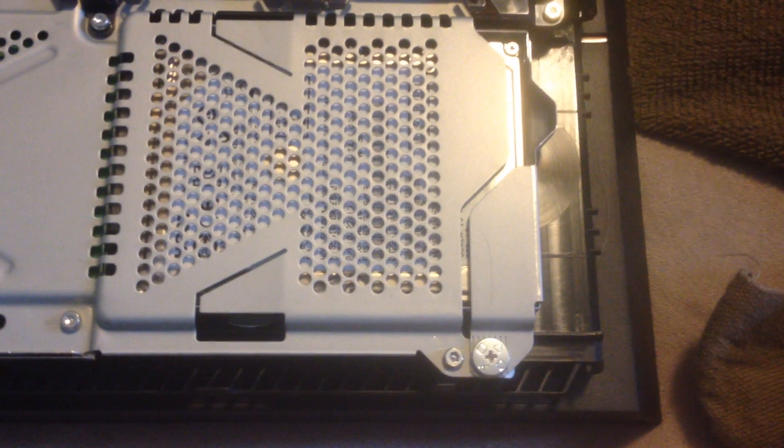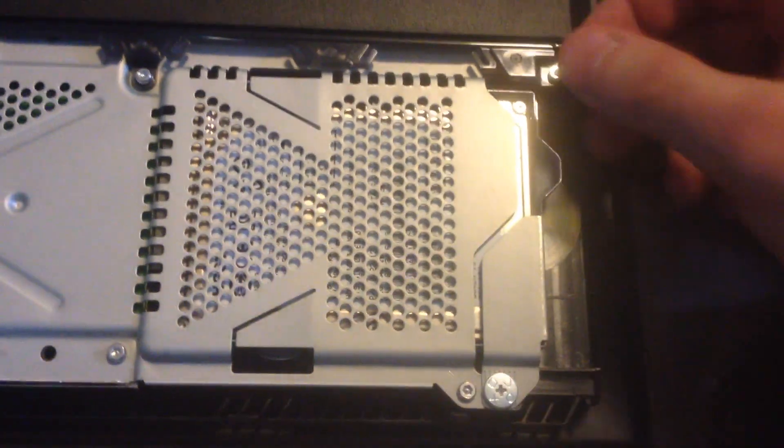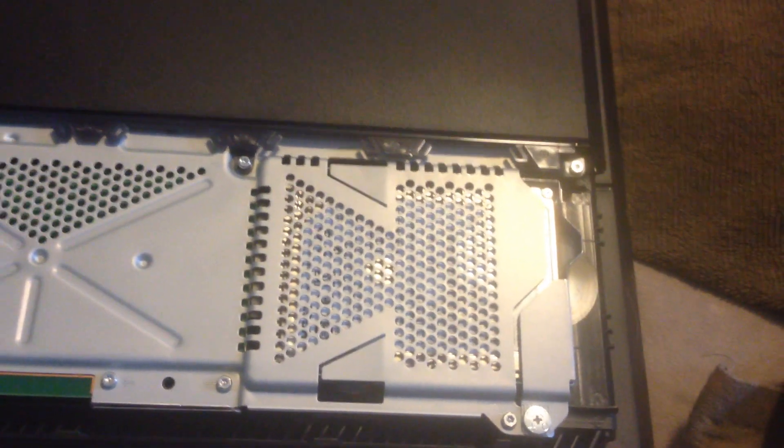Here's my PlayStation 4. To access the hard drive you're going to unslide this right here, and right here is your hard drive. This is just a standard Phillips head screwdriver. You would unscrew this, pull this out right here. There would be four more screws holding the hard drive in. Now for the hard drive, it has to be at least 5400 RPM and it needs to be a SATA 3.